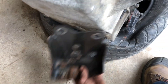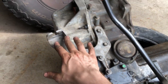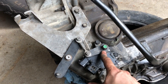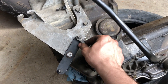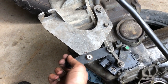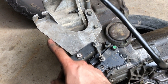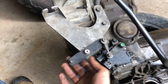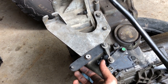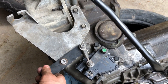I don't need the old bracket on the back of the Fiero — I took one of Raj's brackets. This is the West Coast Fiero shifter bracket. My shifter cable will attach there. You actually have to reverse the direction of this shifter piece because the engine is oriented differently in the GTP. This reverses the motion so it can go in the back of the Fiero. You can probably rig something like this up on your own — some people do it in the shifter itself, some do it on this end. It was around a hundred-some bucks, and it works okay, although it comes without holes drilled in it and you have to drill them yourself.